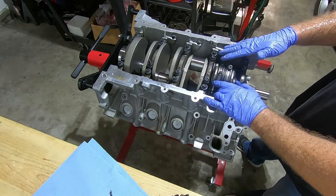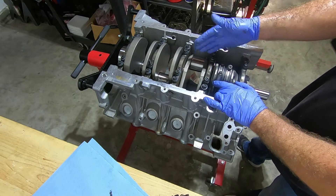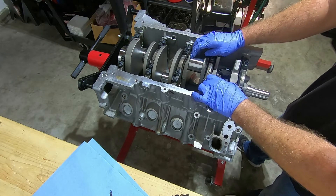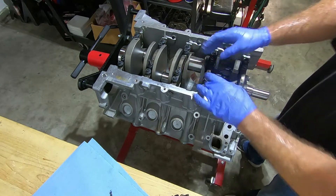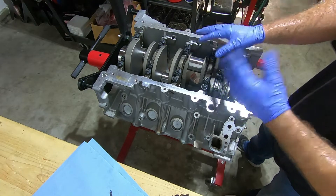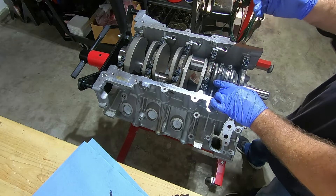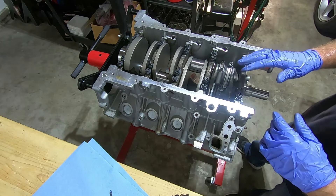Make sure you pay attention to where that narrowed edge is. If you're using a stroker crank, the fillet is this rounded area right here. If you're going to run something like this, you have to have a narrowed bearing or an offset so it's going to be up against that fillet. Otherwise, if you get these backwards, that straight edge will dig into it, and when you tighten them down it's just not going to rotate. So all number five through eight is now going to become one through four, and one through four becomes five through eight. It doesn't matter the placement — everything is balanced, so it should be no issue.